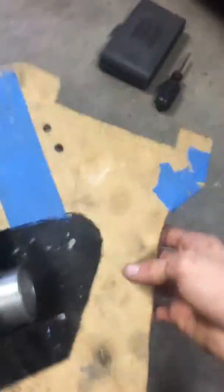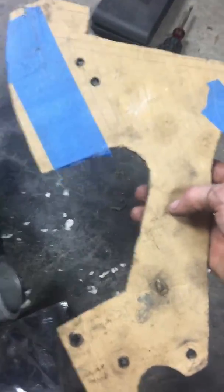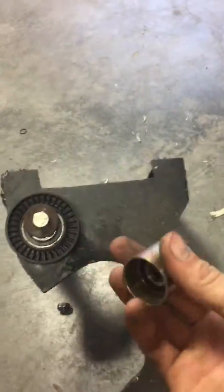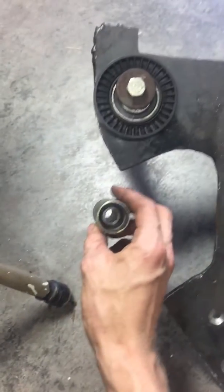To make the template I started off with cardboard, got a rough shape, and slowly trimmed it down, matching up all the bolt holes. Then I traced it out on the steel and cut it out with oxy-acetylene — I tried a plasma cutter but it wasn't strong enough. Cleaned it up with an angle grinder. Really simple stuff.